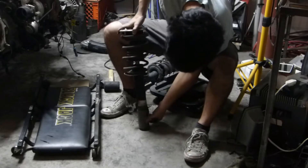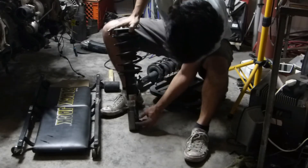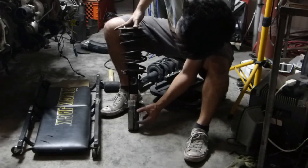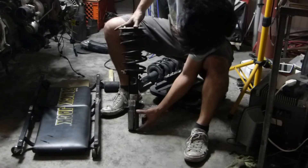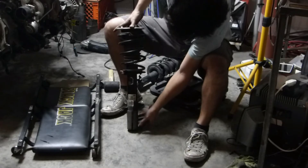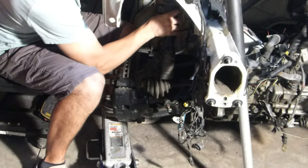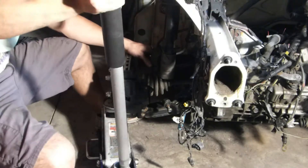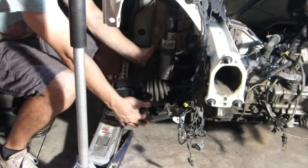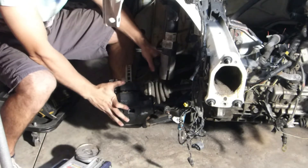We've bottomed out on this piece here. It still gives us most of the pipe — probably just over a half, about 5/8 of the entire pipe, so 62.5% for the nerds out there. Into this pipe now, the GSX subframe and the lower control arm that we've welded in does sit about two inches lower, so this inch and a half here will actually meet perfectly with the top of the hub when I had the car parked and set up.